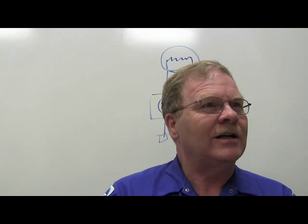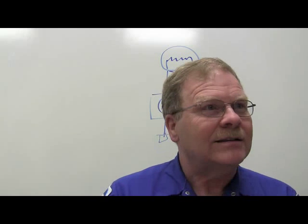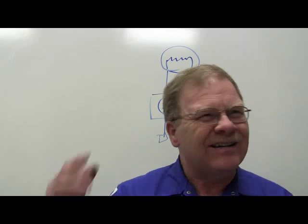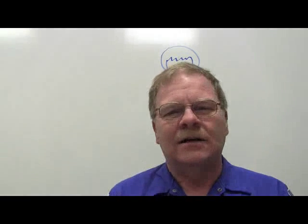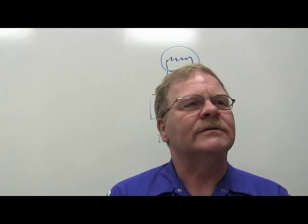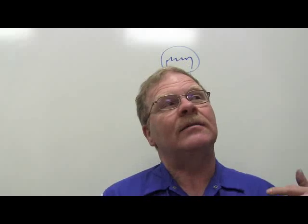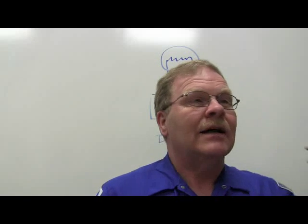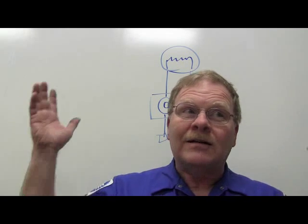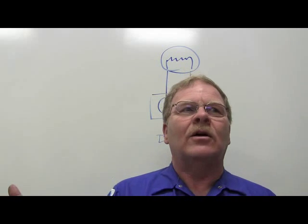You know, and he was a Ford engineer. And he goes, what? What? I said, yeah, that ain't right. Well, the shop foreman had a tendency to be sort of hard-headed, you know. And I says, Philip, that thing has got 210 pounds of compression. He said, that don't make no difference. I said, doggone it, you're telling me it's got 50 pounds more compression on every cylinder than it's supposed to have, and that's not significant? I mean, come on, man. Well, he just really didn't know what to do with that.